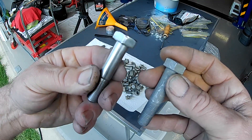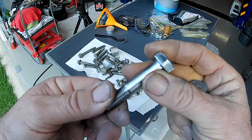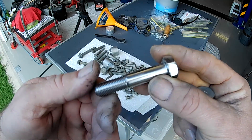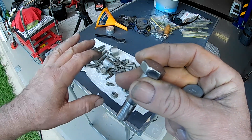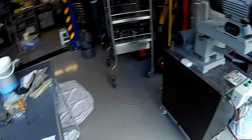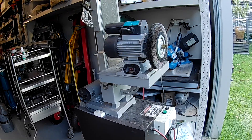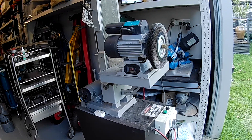To get a good finish with your zinc plating, that's what you need the bolts to look like when they go in. Once all these bolts have been wire wheeled and are all nice and shiny, we start the plating process. The first part of the plating process is that all these have to go into a really heavy alkaline bath at a really high temperature, which cooks out any remaining grease or anything like that, and then from there they get washed off and then we start the plating process. That's the Aussie Shed wire wheel machine — it's an old spa pump with a wire wheel adapted to it. It's an absolute ripper, you cannot slow this thing down in any way, shape or form.